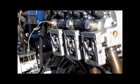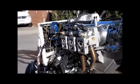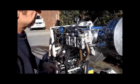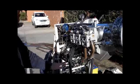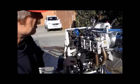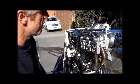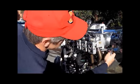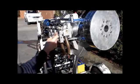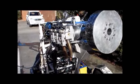And they're not going to keep compressing, holding the valves open, which has been a problem years ago, but Jabiru, like all good manufacturers, they address their problems and they fix them. And certainly this being the latest generation of Jabiru engine, the lifters appear to be working perfectly. They're now using hollow push rods that feed the oil from the lifter all the way through the cross-drilled rocker arm, and they seem to be working great.